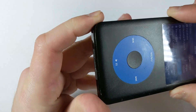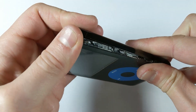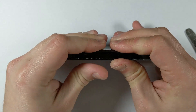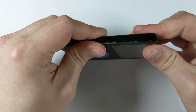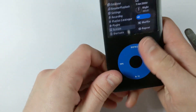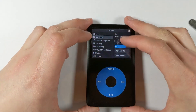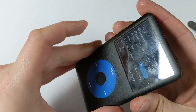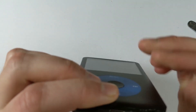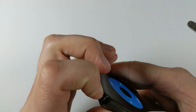Another little tip: if you've got one of these iPod Classic 6/7th gen front plates in black and you've opened it and you can see it's got little silver scrape marks all along the side from sticking the iPod opening tool in, what you can actually do is get a black permanent marker or a paint pen and just go over all those little paint scrapes. It'll cover it up, and since it's sitting in that little gap, the permanent marker or paint pen won't scrub off very easily and it'll just look a whole lot better. I'd recommend doing that before you seal it back up. That's much less of an issue on the silver front plates as they just blend in a whole lot better. If you use a box cutter blade to open it instead of the iPod opening tools you can avoid all those little paint scrapes — I'll have a tutorial for that coming out in the future. It's also quicker, so yeah.